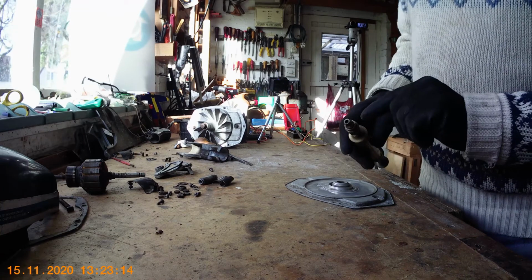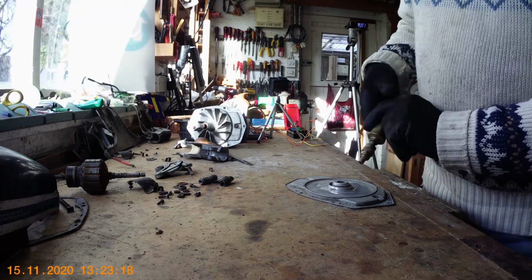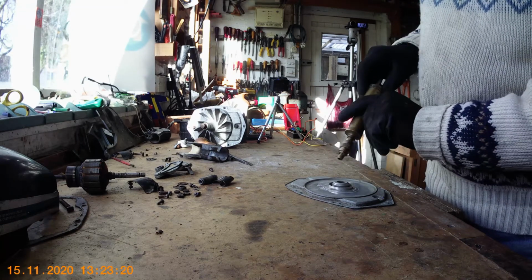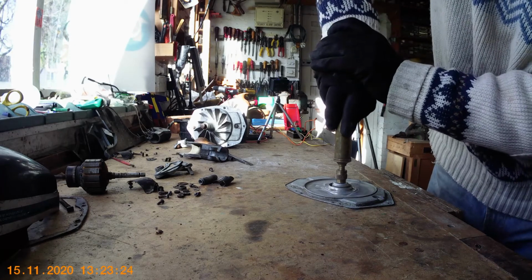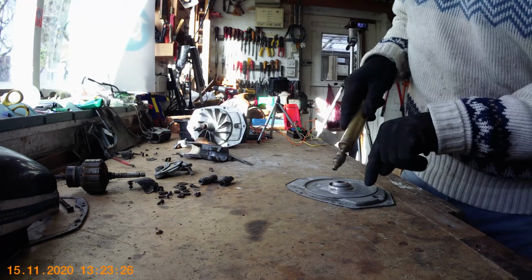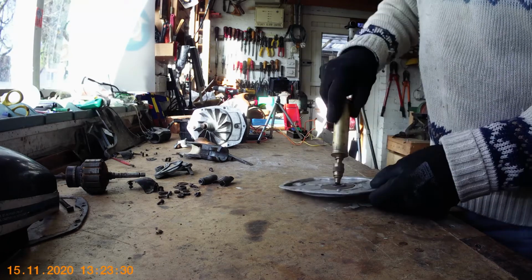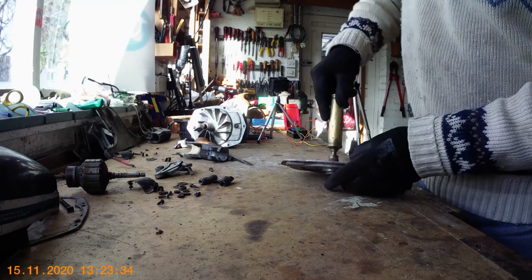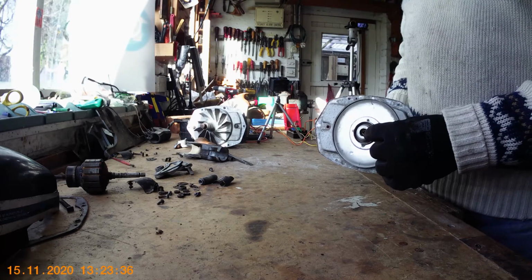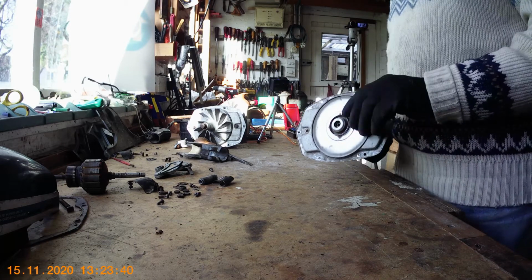If you look closely, there are 4 little tiny holes around there. The bearing is mounted with some felt seals either side, and you pop the gun in there and put a lot of pressure on, and it forces the grease through past the seals into the ball bearing itself. You can do it from both sides. Normally you watch to see the grease appear at the other end. When the grease comes out, you know the grease has got into the actual bearing, so that's what you do.